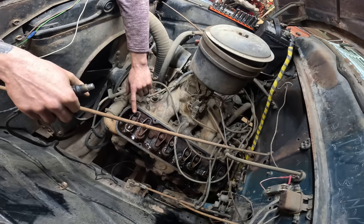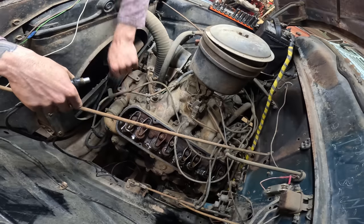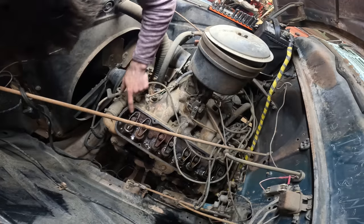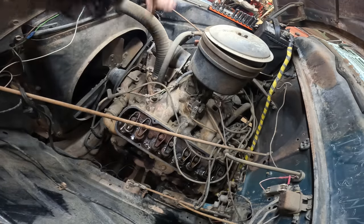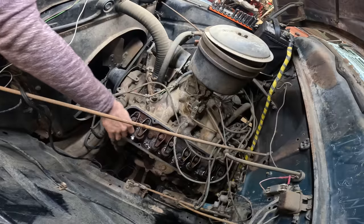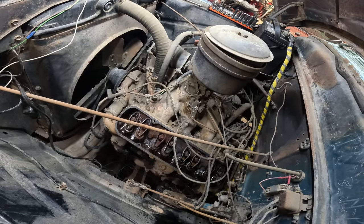We got one froze right here. Oh yeah, it looks like the push rod's filled with rust, don't it? Maybe get some penetrating oil in that, because you could see around it some. It might start moving for us. No, take it off. Buff the push rod and the rocker arm on the wire wheel, and put it back together. Try and suck that dry rust out of there too. Yeah, use a shop vac so it doesn't go down in there.